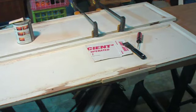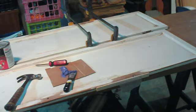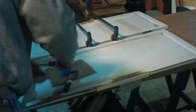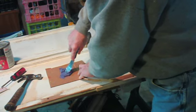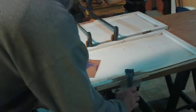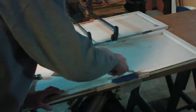The other alternative to doing it that way, you see set up on the other side, same piece of wood, piece of wax paper, but I have it clamped out to mix up our Bondo. The way I was taught, golf ball size of Bondo to 1 inch of hardener. So, jump across in front of you, and all I got to do now, just make a wipe on there, and across there just like you do with some body work. And with the wax paper on there, you don't got to worry about it too much.